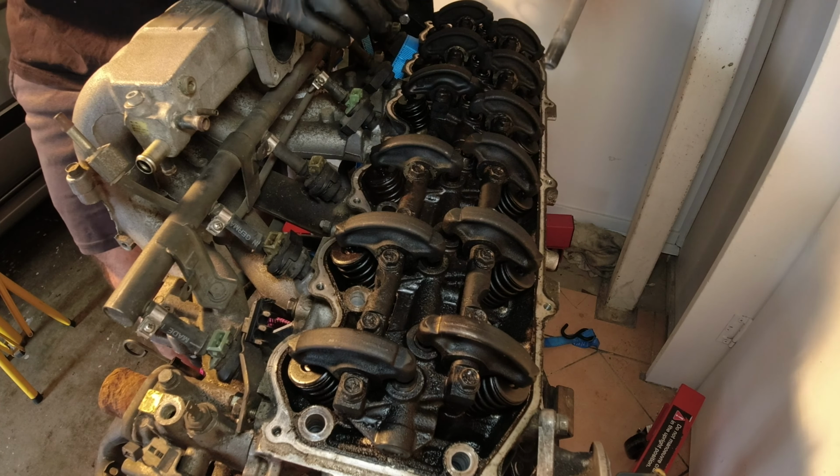It's interesting. Really small throttle body here. I don't know how big that is. I might measure that actually. So it looks like it's about 55 millimeters. Definitely not 60. I think the throttle body in my Stagea with the RB25 is 63 millimeters or something around there. So that's a decent increase in throttle size from say 55 on the RB30 to I'm pretty sure it's 63 or 66 millimeters or something on the RB25. That's a decent jump in size.